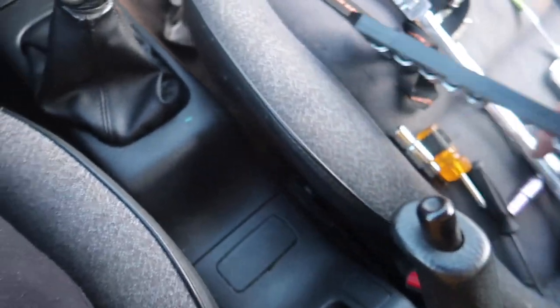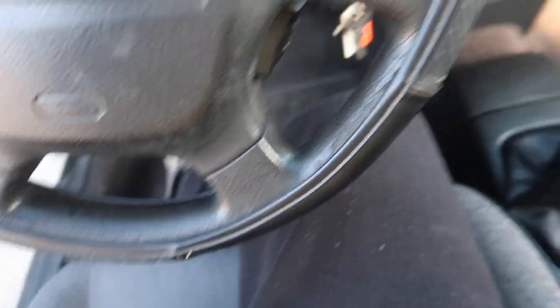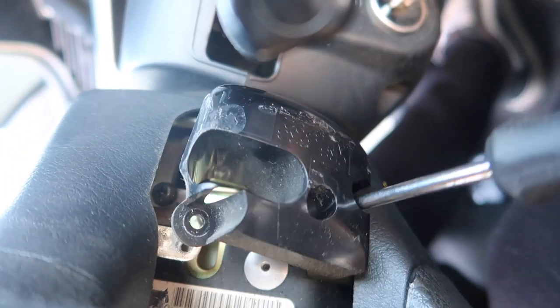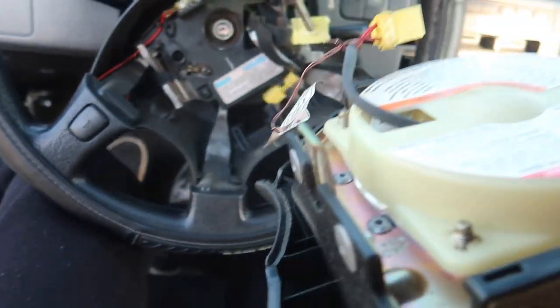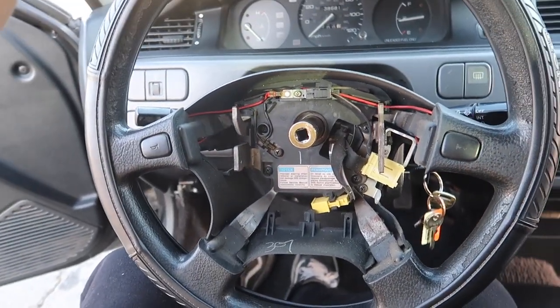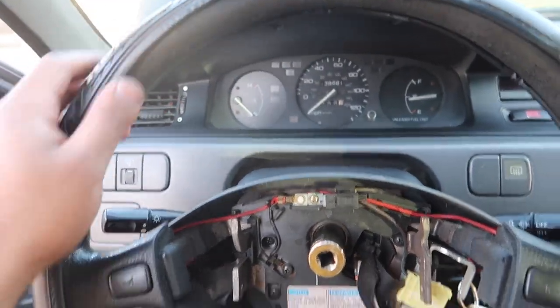To get the steering wheel off: disconnect the battery, then you have one bolt right here to take out — that was a T30. Next one is another T30 which is in here. That'll release the airbag. This thing pops off just like so and I already disconnected it, so we're good. The reason we're taking off this big steering wheel — check this out — I can flip this whole thing around, it's so flimsy and ugly, and it has this big book. It's just a mess, so let's get it off.